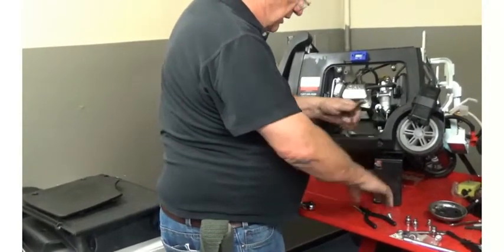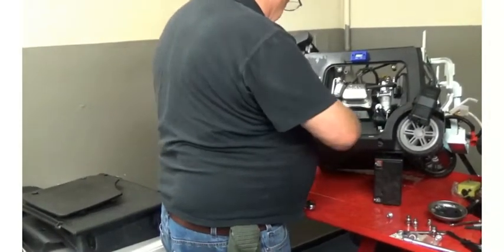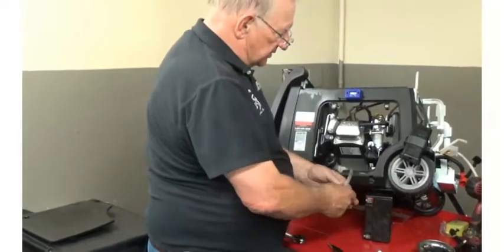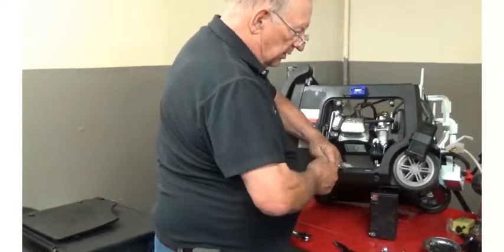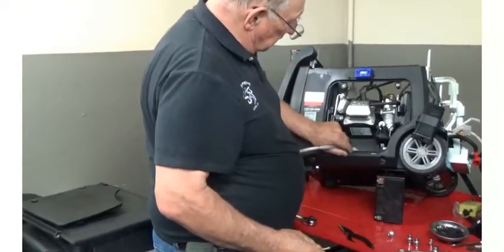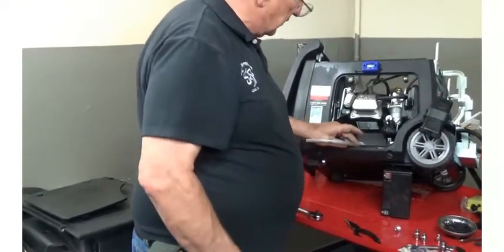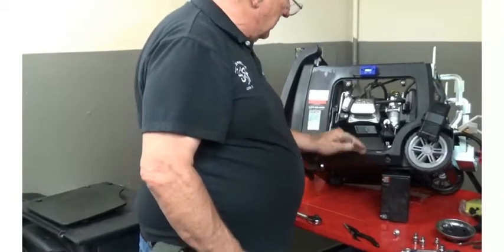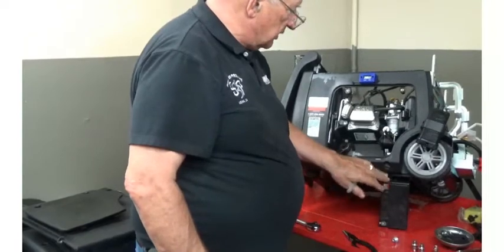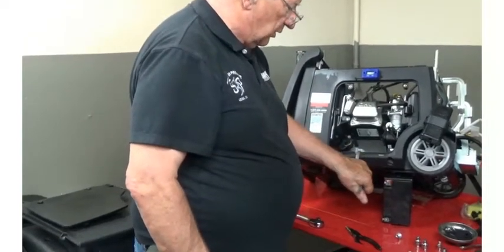That's the long and short of it. Now to drain the oil, the only thing you've got to do is slide this spring clamp down the hose a little bit and pull this blind plug out. This little notch in the chassis on the 3100s makes it handy just to set the hose there and drop it in your pan. And once we take this prop down, the oil will drain right out.